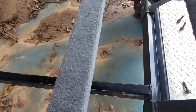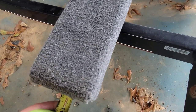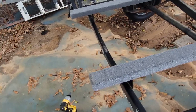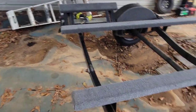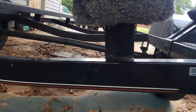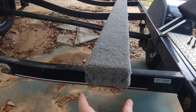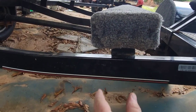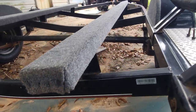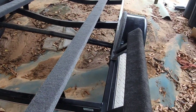This is why I'm redoing the bunks — this is what was on it. Not acceptable. I'm not letting it ride like that. I measured from the bracket to the board before I took it off — it's nine inches — so I've got both sides set to match. Making sure the board is lined up in the center of the bracket itself, then I pre-drill those holes and shoot the lag bolts in.